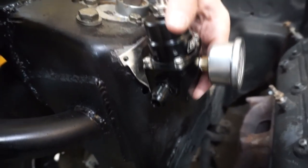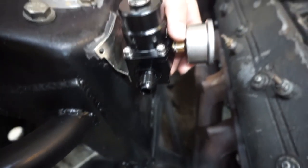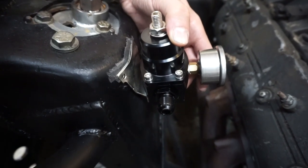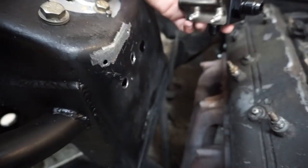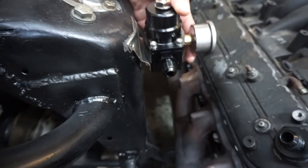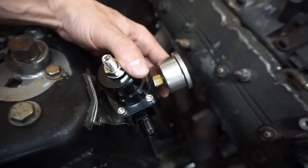Getting a little creative over here — I did drill some holes and I was going to bolt it down. I actually bent the bracket so it would match the strut tower, then I was going to bolt it on. Then I decided — because I didn't have any bolts that were the right diameter — I was going to use a metal tie to just tie it on, but I couldn't really get it tight and didn't really feel like messing with it. So what I'm going to do is weld it on. I did drill some access holes here and here so if I do need to remove the regulator I can still get to the bolts on the back side, because it's pretty tight back there.